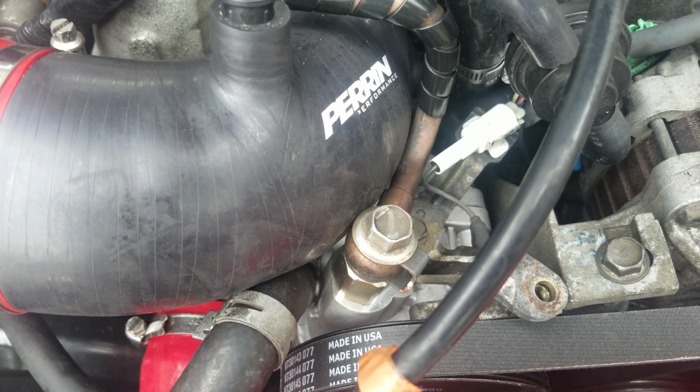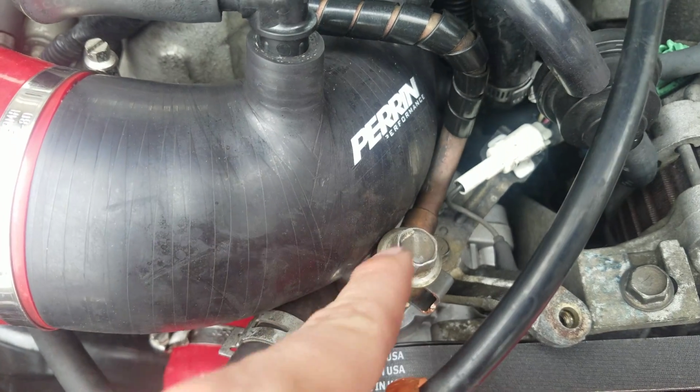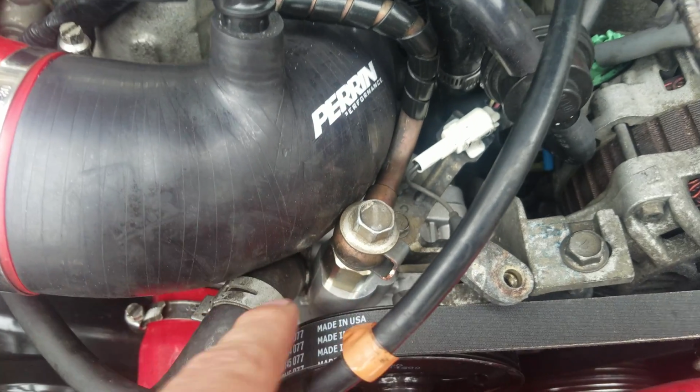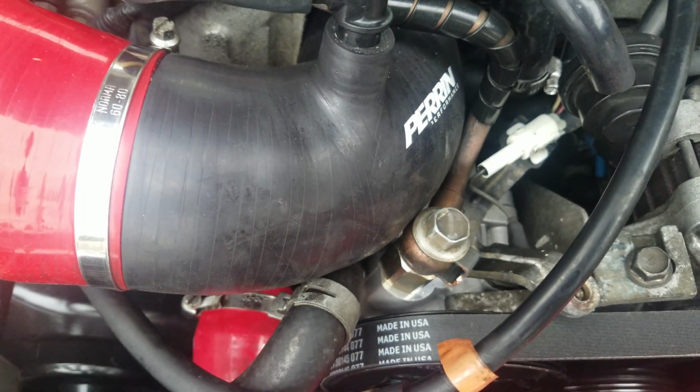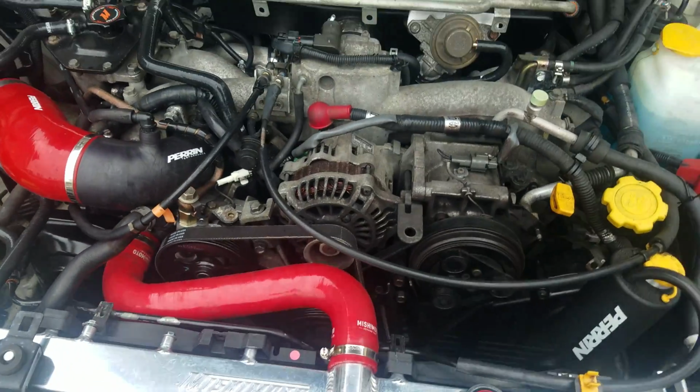And when I put it back on after I finished installing everything, I had the bolts tight all the way, but the holes weren't facing to let the fluid flow, and so it was backing up, and it eventually broke my pump. After only driving it around for a little bit, mind you. I really didn't drive it hard. I didn't do anything stupid.